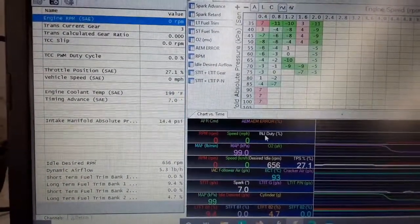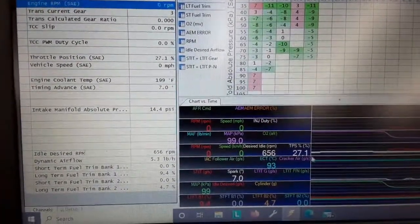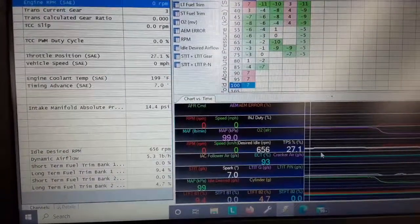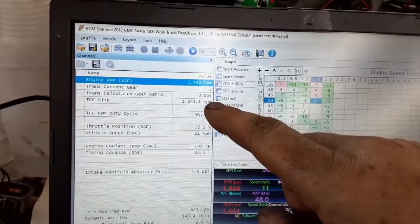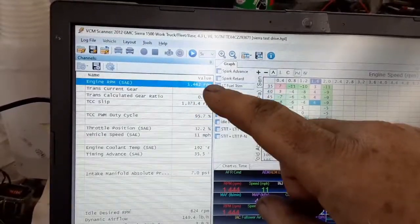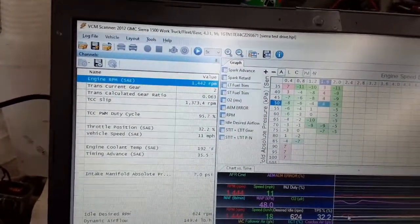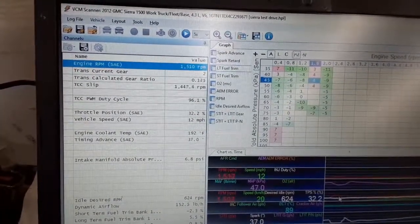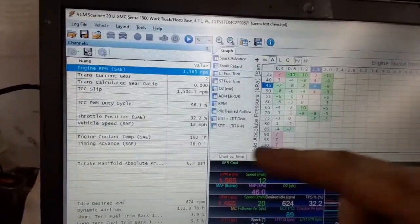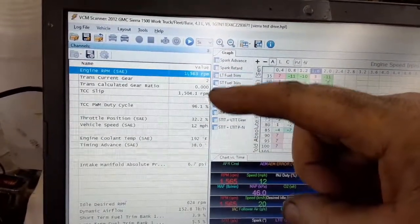The test drive is over. This is an old log file from before I changed the transmission — my bad transmission. The transmission was slipping: doing 11 miles an hour in second gear, I'm slipping almost all of my RPMs — 1,400 slip out of 1,440. So I had about 50 RPM actually driving the vehicle. As I kept applying the pedal I wasn't accelerating the vehicle and I was still slipping completely.